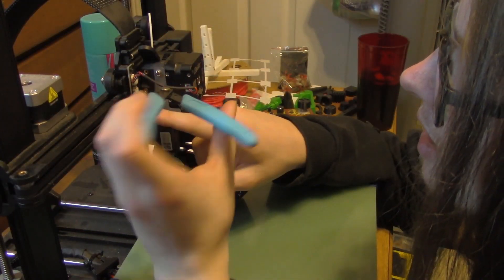Now I try to unplug the fan connection, but they've put hot glue blobs on top of all these little connectors — most likely to keep them from falling out during shipping or first uses. I express frustration with this. Creality removes their blobs with side cutters, which is a problem: you have to pinch the glue just right without cutting it, and if you cut it your grip comes loose. The other issue is the area you're working in — a Creality tutorial even says 'be careful not to cut any wires,' which is easier said than done.